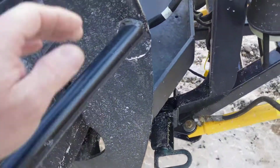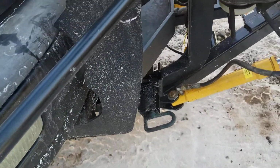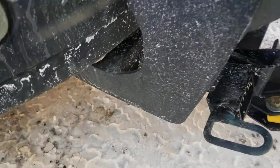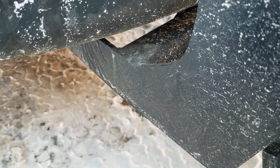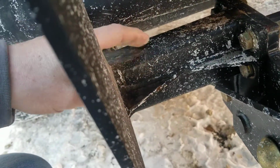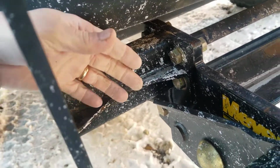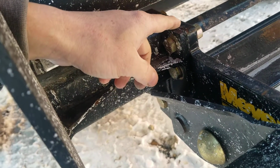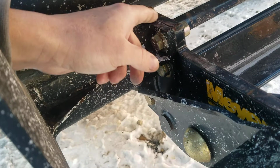Basically, this winch mount and bull bar, or whatever in the hell it is you want to call it, is made out of 3/8 steel, so it's pretty stout. What I done was I took, I think this is 2x2 square tubing. I welded 2 pieces of that with gussets on the front and the back to kind of support it inside and outside. And then I went to a machine shop that had a plasma table, and I had them mirror image the mounting points on this clevis that came with the plow.